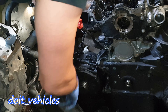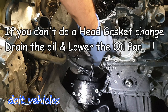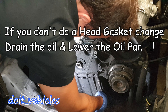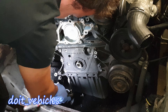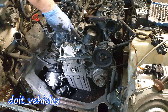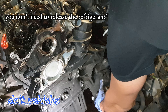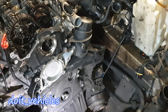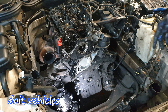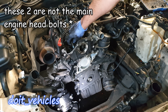Now let's take the alternator down. You can see the oil pan connects to this chain cover, so we need to remove those bolts around. I took the AGR valve off. Now I have to take out the power steering pump as well and the AC compressor — the AC compressor was held on by 3 bolts. There's some coolant leak right there — that's a good sign. I also forgot to mention you have to open these 2 bolts which hold the engine head on the engine block.